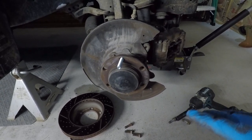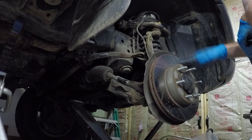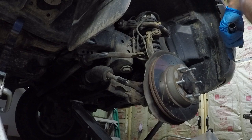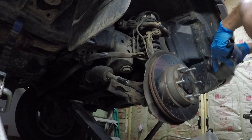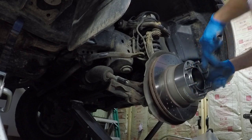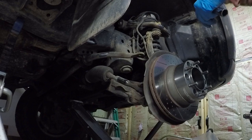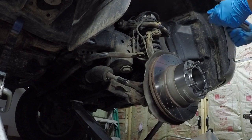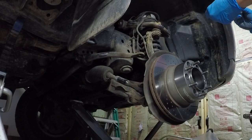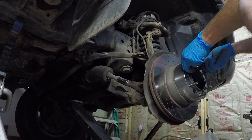Don't forget to put your brake disc back on — we have all the studs pressed in but it's easy to overlook that and get busy doing something else. It should fit on real good just like that. We're going to take the nuts they gave us and get some Loctite — just put a little drop on the threads and go on down the line.